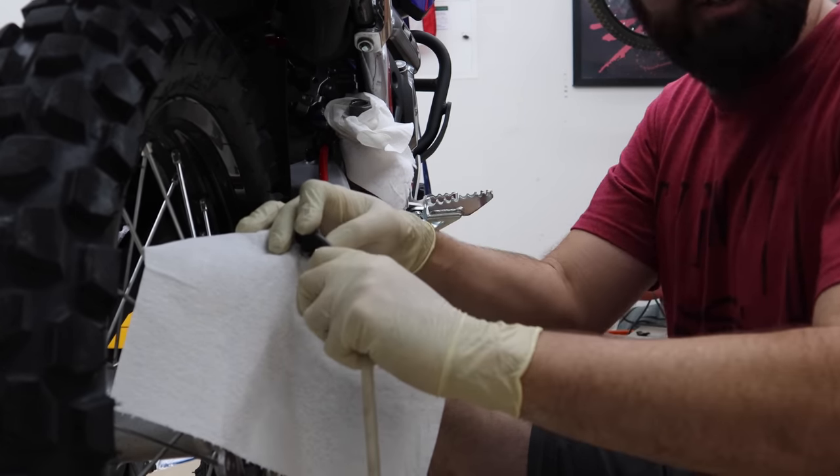I'm so shocked by how quick this pulls the fluid. Feel how this feels — oh dude, that's almost there. I'm giving it a quick pump, going to push down hard while I crack it and then shut it. That's it right there — we hit it. It's so easy with this tool. I've got a little bit too much fluid in there, but I'm going to put this cap on — it's got a little rubbery bit — tighten it up and let it just sort of pee out what it doesn't need. Looking good. Let's move on to the front.